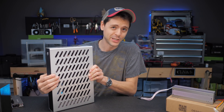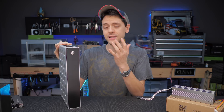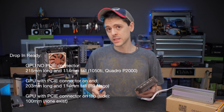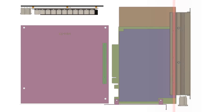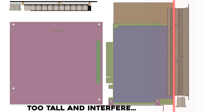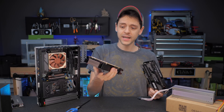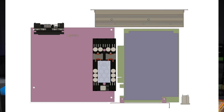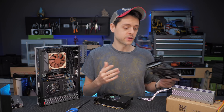I'll conclude by talking about helping out S4 Mini owners. The real excitement surrounding this power supply in our community is its potential to be used inside the mini with a very powerful GPU — a brickless build. You can get GPU measurements yourself using calipers, or look at technical specifications on the manufacturer's website before you buy. Sadly, this means you can't use Zotac Mini 1070 and up cards with the 400 AC installed — you'll have to use it externally. Advanced builders will be able to make some cards work, like the NO3D 2060, the Vega 56 Nano, or some Gigabyte Mini cards. I suggest taking the discussion to my Discord channel, where people are already attempting these mods.